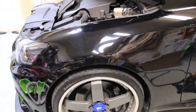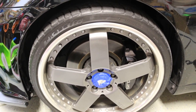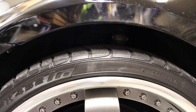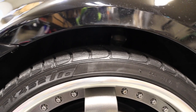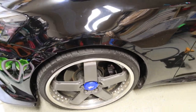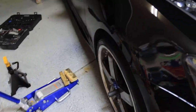My initial adjustment was a failure, it looks like. I should have left more of the bottom half screwed in. When I lowered it down, it looks like now I've got like a 2-inch gap. Before, with my lowering springs, I had probably a 1/2-inch gap there. So that was a failure. I'm gonna have to take it all apart and readjust this sleeve at the bottom lower.